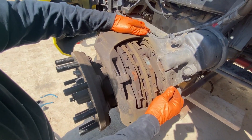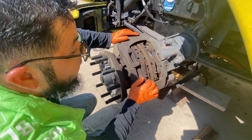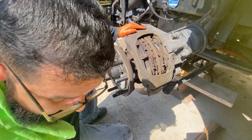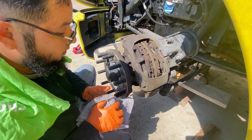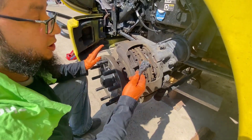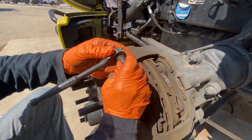Now this system is pretty much like a car brake setup, except this works with air, of course, not oil. So we just got to come on this side, and what you're going to need is a ratchet — I believe it's 10 millimeter, yeah, a 10 millimeter ratchet — because you're going to need to loosen the caliper.